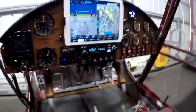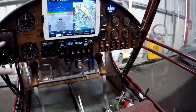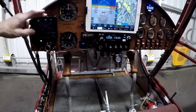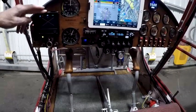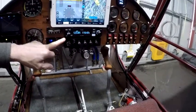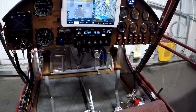Going around to the inside of the airplane, it had 1992 instrumentation, so I opted to put in an iPad with ForeFlight, which works really well. New instruments from UMA in Virginia. This is a Dynon D3, which isn't working because we're in the hangar today. Then I upgraded the radio and used the old transponder, and was able to install ADS-B through uAvionics in a neat little package that fits right behind the seat — it's about the size of a cassette tape.